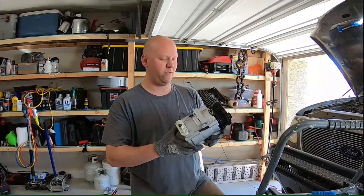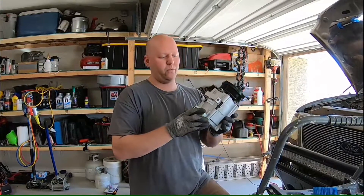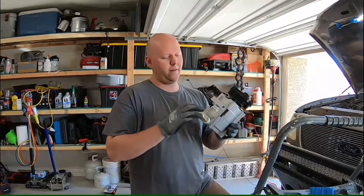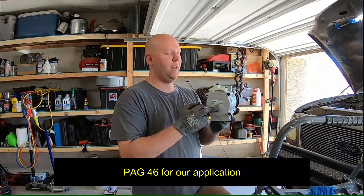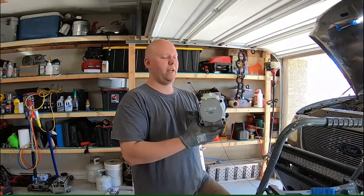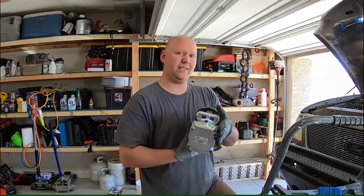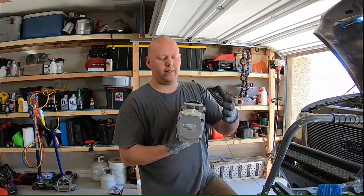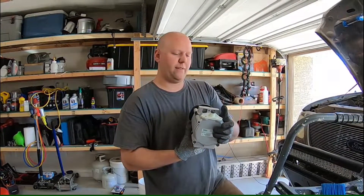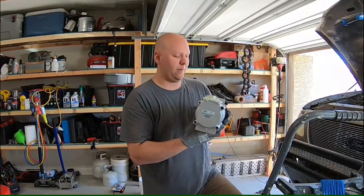It's just like the engine in your car — you have to have oil, otherwise you're going to destroy it. This compressor says 'please add PAG oil' — 6.75 ounces on the back. Your compressor may be different. Some do not need any oil — they come pre-filled. Dorman does that a lot. Others come with some oil and you have to top it off. So read the instructions. I know a lot of people don't like to, but this is one case where you have to.